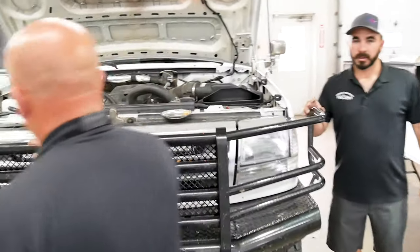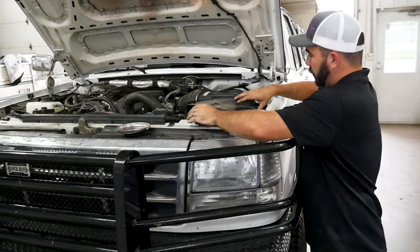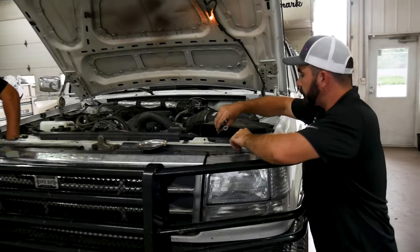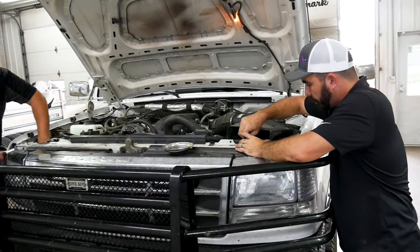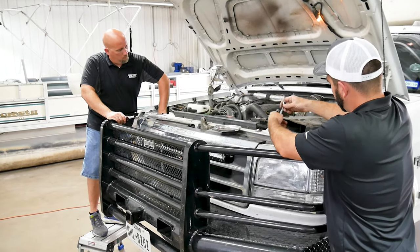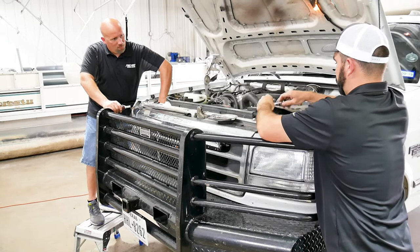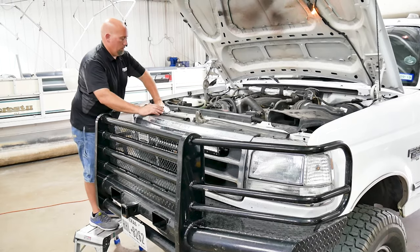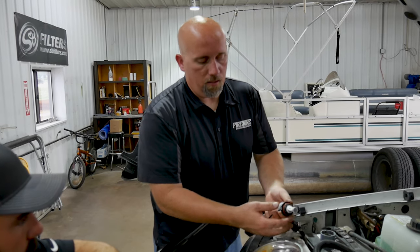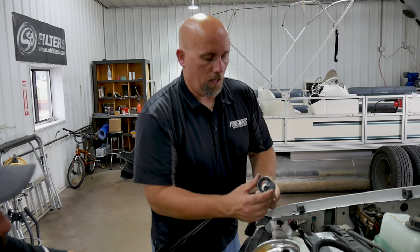In the meantime, getting that bulb out, this side, snorkel goes back in place. Obviously mine again is 10 millimeter, not 8 millimeter, so on the bolt up, snug it down. That like 30 seconds that it was on, now it's hot. Again, take your set screw out, wiggle that off, put your lock collar back on.